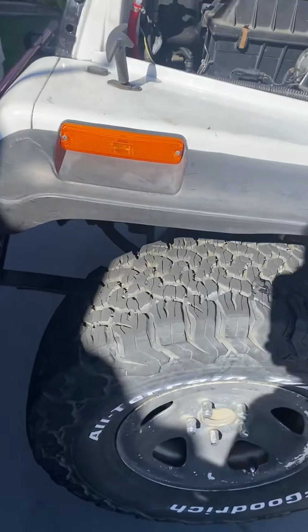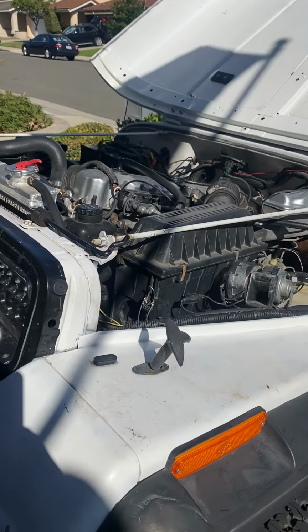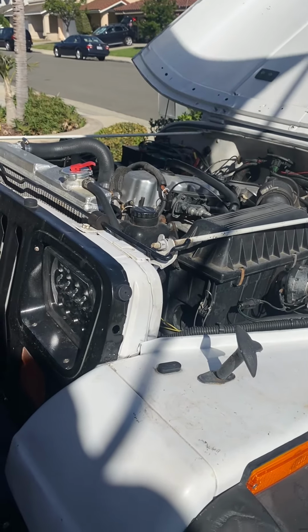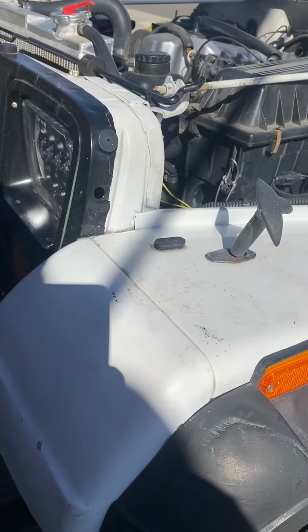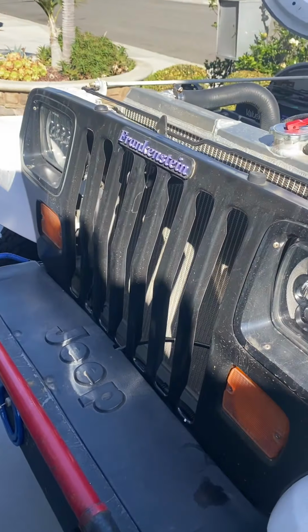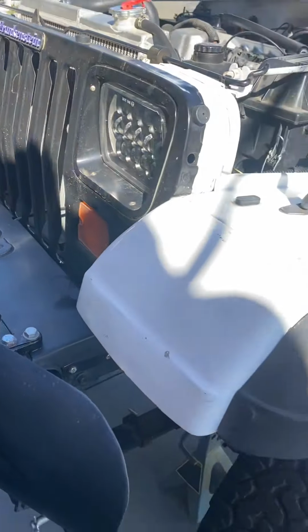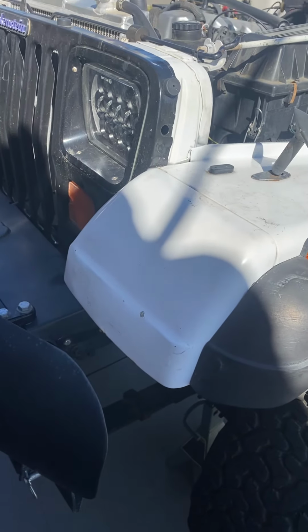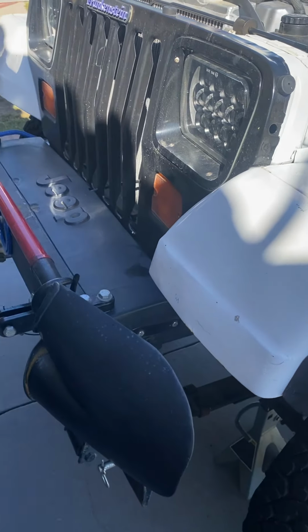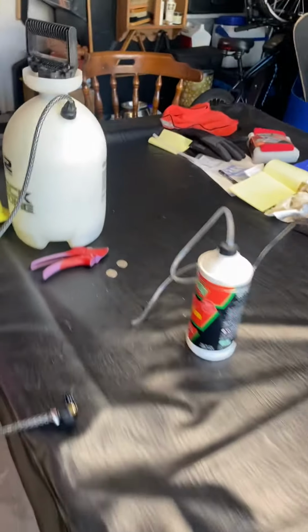I bought a big syringe to force fluid up from the bleed valve up to the master cylinder, and I took an old master cylinder cap and modified it so that there was a hose coming out of it leading into a bleed bottle. But the problem is, through that tiny bleed hole, you can't push enough fluid to offset that plug. You got to move a high volume. So here's what I came up with, and I'm going to show you my system here.